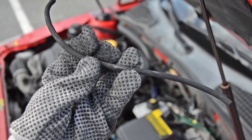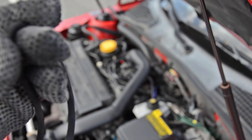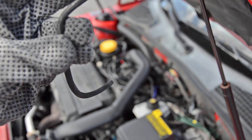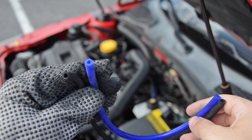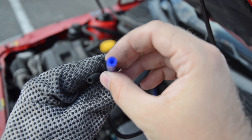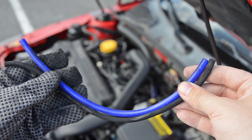This is what an old rubber hose looks like — crusty, hard, brittle, probably will fail on you. And if you bend it, you'll probably start seeing small cracks. After taking the hose out you can measure up a new hose from the blue silicon line. This new line has an inner diameter of 4mm and an outer diameter of 8mm, which we'll be using for this entire procedure. So measure up the same length and then put it back in.